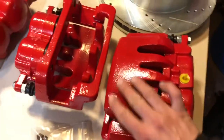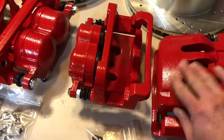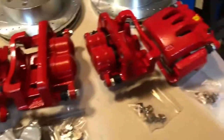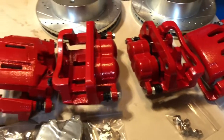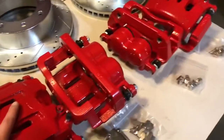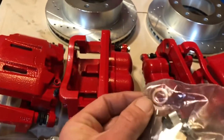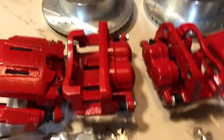There are a couple of chips — about one per rotor — a little chip here and there. The paint is really nice; I'm considering whether to shoot them again over their paint, but the issue is if my paint isn't compatible I'll get spider cracking, so I'll probably just leave them. They're the red that I wanted, and this isn't a show truck — I just like pretty things. The brake pads all came with clips. Another nice thing is there are brand new brake hoses, copper crush washers for the brake hose connection, and brake clips for the pads.